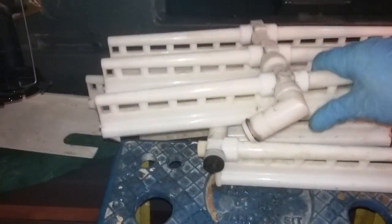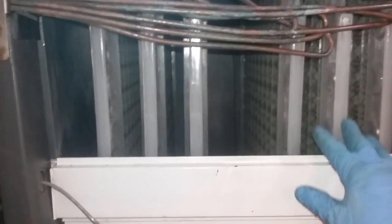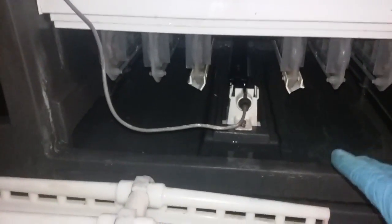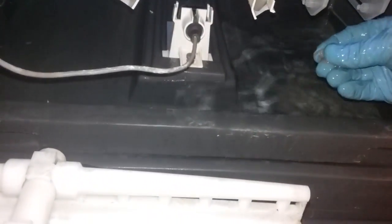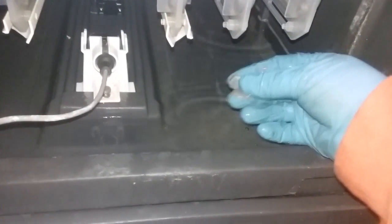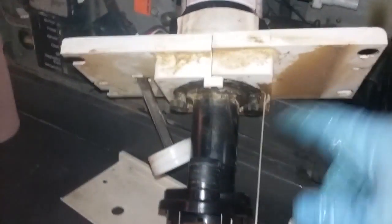All right, so here we are. I've got my water feed supply lines all out. This is the evaporator — several evaporators — where we make ice. Got all my parts taken out. I'm going to clean all this. See all this stuff in here? That's all minerals from the water — all this has got to come out. I got my motor out, I'm going to lime-out the motor and clean all that off, then clean the reservoir.